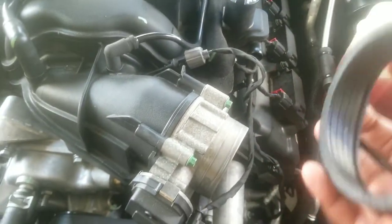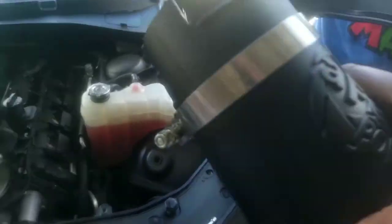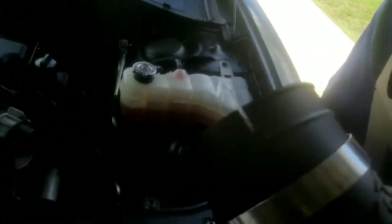This piece goes over your throttle body — flat side going first with the ridges on the outside. Push it on there. Your tube has to go through the holder first before you put it on the throttle body because it won't fit after. When the tube goes in, it screws in on both sides — take the hardware they gave you and screw it in.